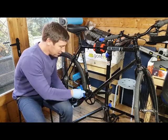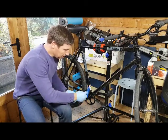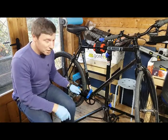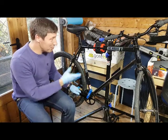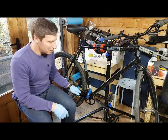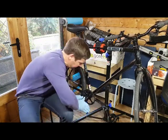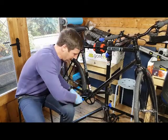Push the tool in finger-tight, make sure it's fully bottomed out, then start to rotate the extractor. On an older bike that's been on for four years, this gets really hard — you'll probably need the bike on the floor with someone holding it so you can put lots of pressure on. But you can see this one is going to come off quite easily.